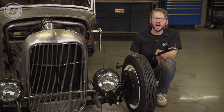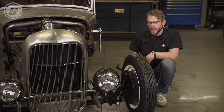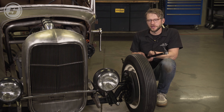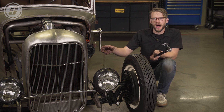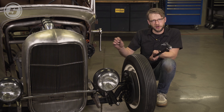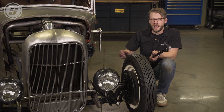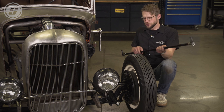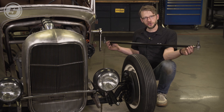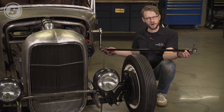We sell an awful lot of these and people always have a question about how to measure. The simple answer is you always measure eye to eye on your steering arm, or pitman arm to steering arm. Center of hole to center of hole is the measurement you spec when you call or place your order on the site. What that means is the length of the tube is going to be three inches shorter than the specified measurement with the rod ends installed.